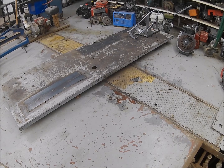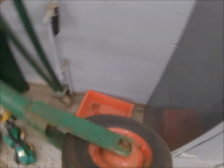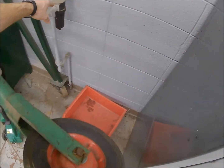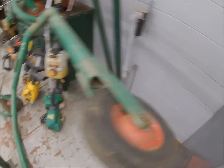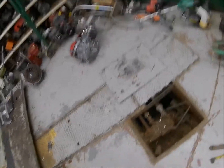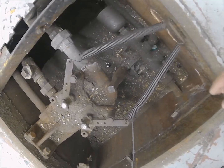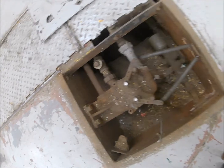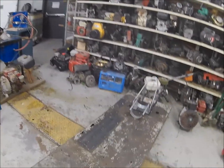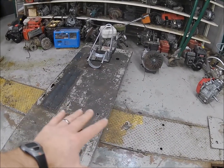This is an old, old school lift. I pulled the cover plate back — this has one compressed airline that comes in. My air filter leaks pretty good here, but you've got one compressed line that comes in, an air filter, and it snakes along and goes down into the ground. You can see the line comes in here — same kind of blow-off canister — and then it circles around and goes into this mixer. This lift was designed for old vehicles; the front cylinder would slide up and down this metal plate per your vehicle's wheelbase.